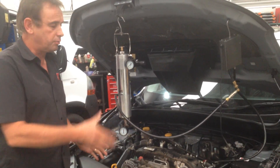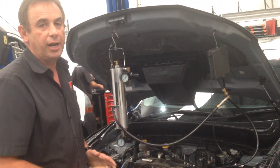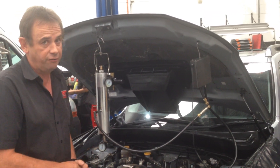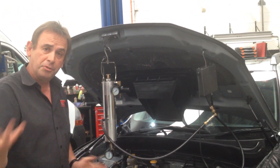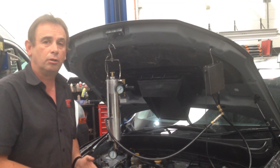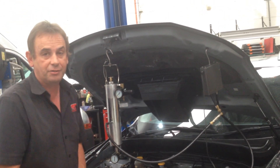But if you're looking at Subaru turbo diesels and you've got a problem with your DPF, this is something that we can address. This particular client was worried he was going to have to pay for a brand-new DPF. We've managed to save it — we've washed it down without having to remove it — and now this car is going to go a hell of a lot better than when it first drove in a couple of days ago. If you're interested in performance tuning of your Subaru turbo diesel, that's one of those improvements that allows us to adjust the settings in the ECU to further save you money on long-term soot build-up, so the cost of the tune will actually pay for itself in the long-term without having to pay for costly inlet manifold cleaning.